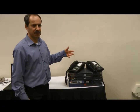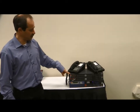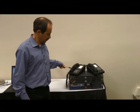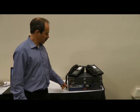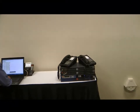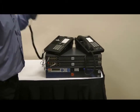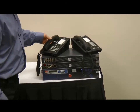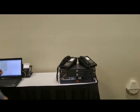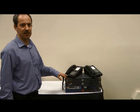As a result of some lightning problem with the electricity network, the upper Asterisk bank has been burned — I simulated this by just disconnecting it from the electricity network. Also, let's say that our Asterisk server was rebooted for some reason. After reboot, the survived Asterisk bank also doesn't work. This is how Asterisk systems worked before the new plug and play feature was developed.